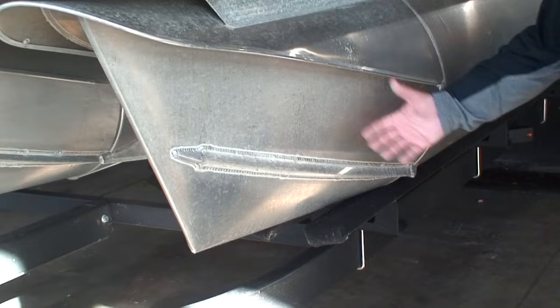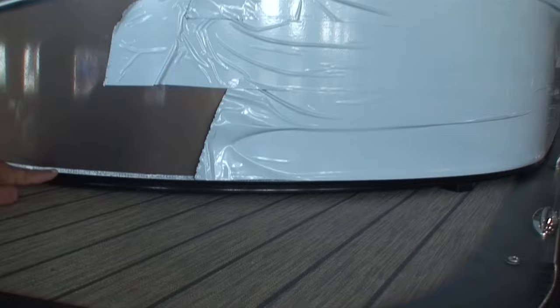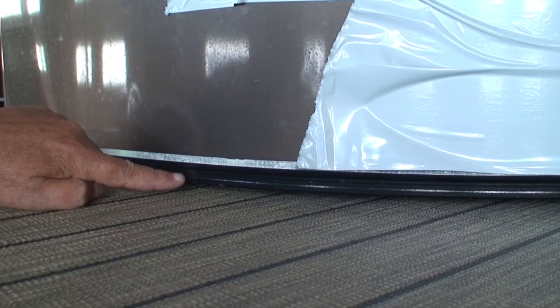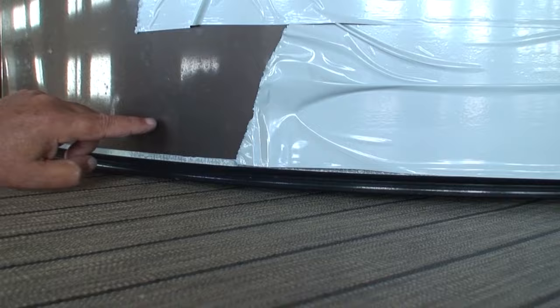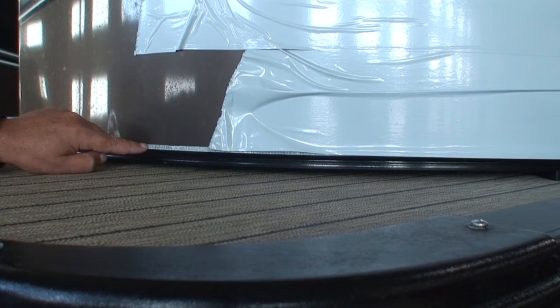Here's an example of what I mean by the sheet metal being on the outside of the fencing. You'll notice this silver stripe — the sheet metal slides down in between this silver stripe and the fencing frame and is pressed in to hold the sheet metal in place. I don't see any foam tape in there. What most brands do is apply foam tape so that the sheet metal doesn't rattle down the road. Sheet metal can rattle without any foam tape in there.